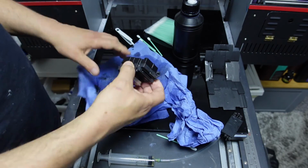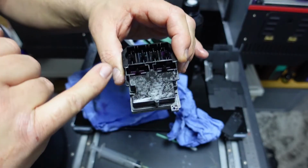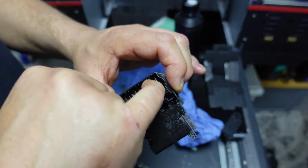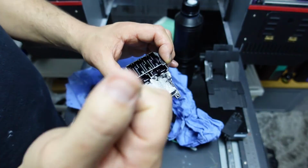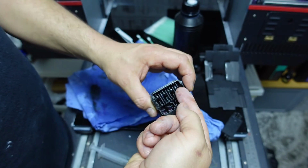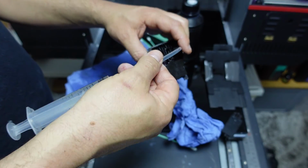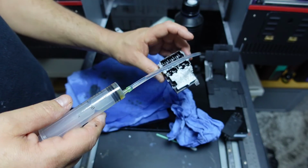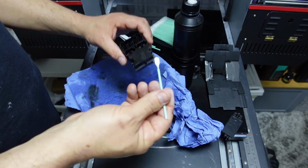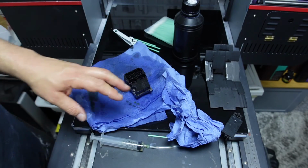So yeah, that's it. Oh, one other thing. When you do this, you may get little bits of stuff down inside around the needle. Try to suction all that out first, because the last thing you want is to put the damper on top and then start pushing ink out and push ink over to this side and stuff. Just try your best to get the syringe down in there and then suck it out. Okay? Also, what I did, I found that these things were handy for that, because if there's a puddle in there, you push it in there and it will just totally soak it up.